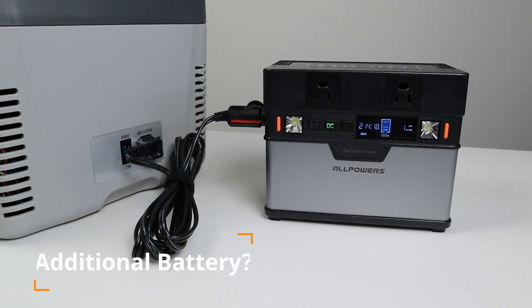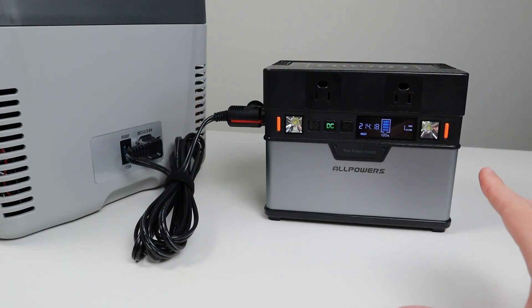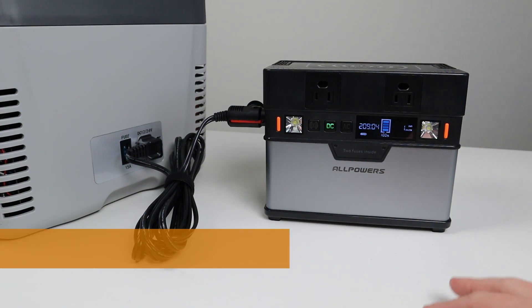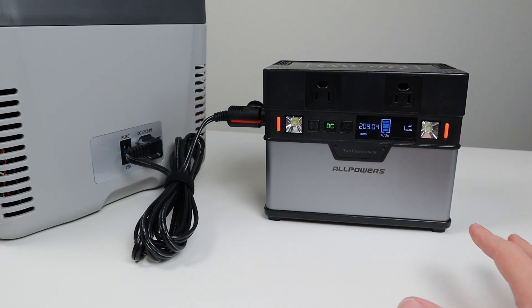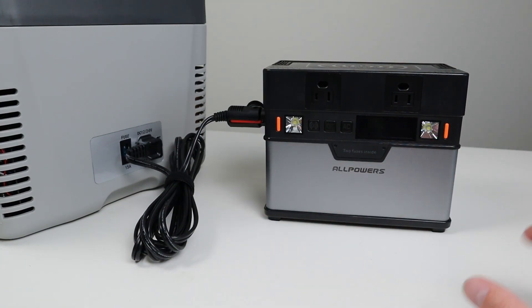For anybody just getting into the hobby of 12-volt compressor fridges, I always recommend purchasing a portable battery pack. One of these can be charged many different ways — this one can be charged via solar, via 12-volt input, and has a lot of other handy features. The reason I recommend that is so you don't draw your starter battery down too low and end up stranded with your vehicle. Yes, it's easy to run one of these on your starter battery, but it's always safer to run it off a different battery. There are many on the market — this All Powers was one I reviewed on my channel and it's a great budget option. You also have the Jackery Series, the Goal Zeros, and even the Bluetti, which are a little more expensive but offer very similar features.